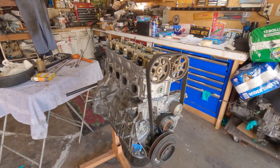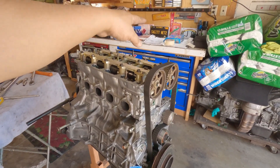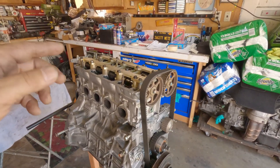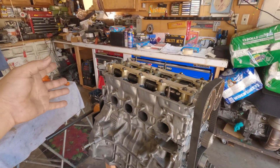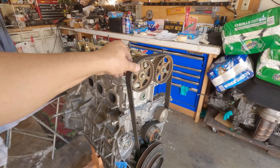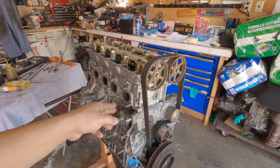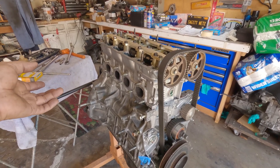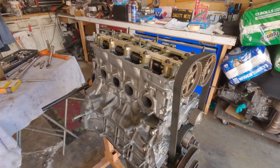This is pretty much like a stock build. All I'm having on this one is just the intake and the exhaust. But if you are thinking about installing high-lift cams, I would highly advise that you clay your motor. But something like this, where I'm just using a base camshaft together with the USDM 11-to-1 compression pistons, I should not be worried about it.